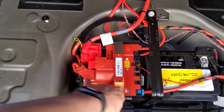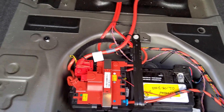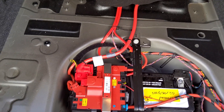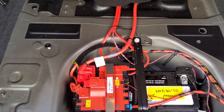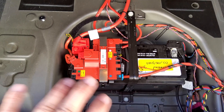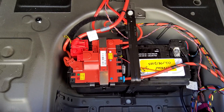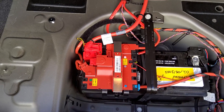This is a super helpful sensor — it helps us with diagnosis and it helps the customer. It tells the car exactly what the alternator needs to charge at. If your battery is below 50%, for example, your alternator output would be a lot higher than if it were at 100%. It will also cut off amenities for creature comforts or sensors if the car is too close to its startability limit, which is the lowest charge point the battery can be at before the car will no longer start. So it makes sure your car will start as long as the battery has enough juice, by cutting out some things.